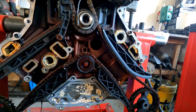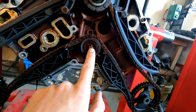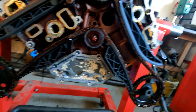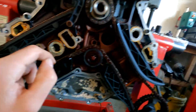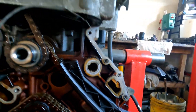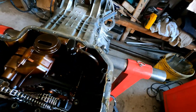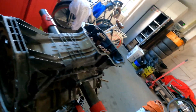I checked before taking this cover off and found that one bolt has a non-standard thread — it's a left-hand thread, not a normal thread. So this one bolt needs to be loosened the opposite way. This is the only bolt that has a different thread than all the others; normally you loosen left and this one goes the other way — very good to know. You can also see the oil passages here and here, and the cooling passages into the block. It all looks pretty good. I'm going to put this away and start removing the bottom sump section, leave the oil pump in, and then we can see the main bearings and the flywheel.